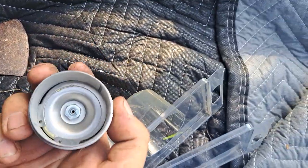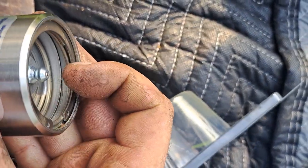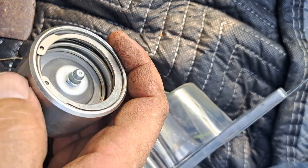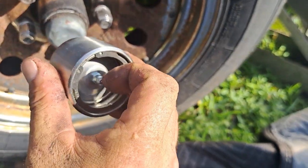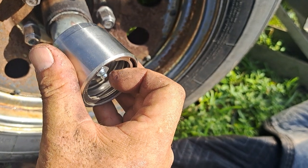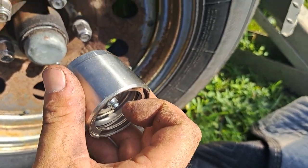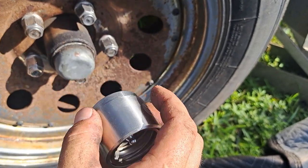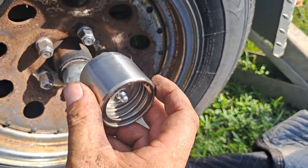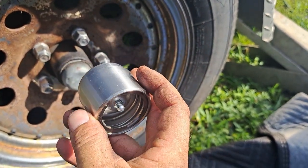These things are really simple. There's a grease fitting, and if you look in there, there's a spring that goes around. When these go on, as you pump it up with grease, as it fills up it closes and squeezes that spring. As it needs grease, the spring pushes this down and keeps the bearings full — that keeps you from ruining your bearings.